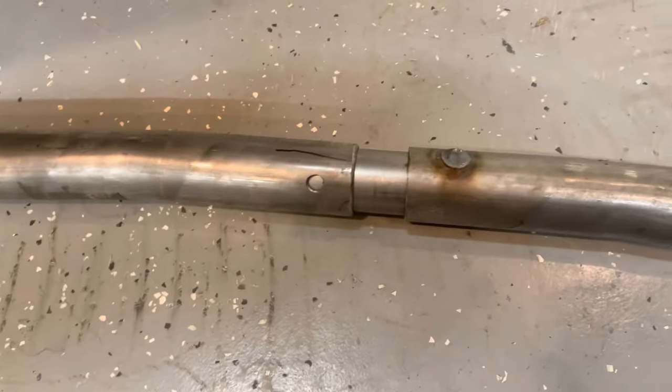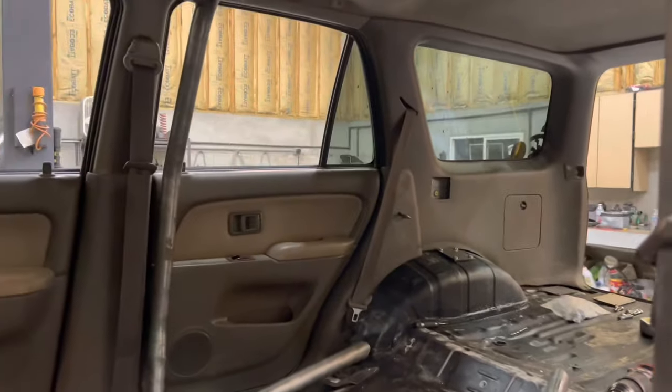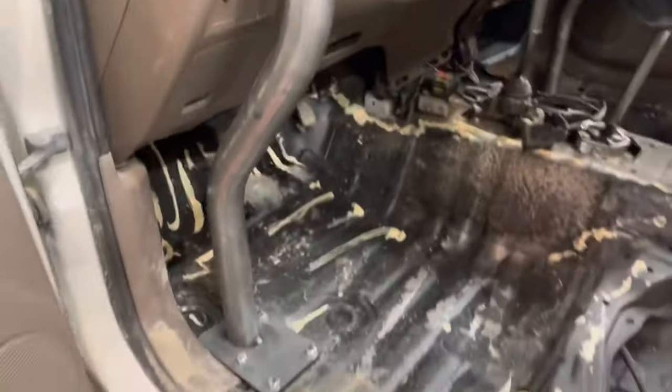Then we're going to land the tubes in the corners from the B pillar to the C pillar and tack everything in. The one thing I don't know — and it doesn't say anywhere in the 4x instructions — is how to finish weld the whole cage. Their first-gen 4Runner kits have a removable hard top so you can slide the front half out and finish weld it. This one is a full-length cage going all the way to the back. I have no idea how to weld some of these joints without melting the headliner.